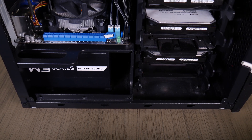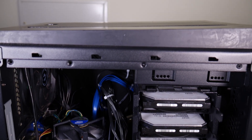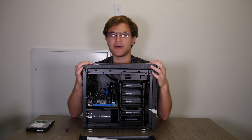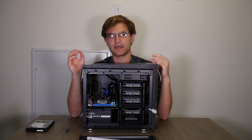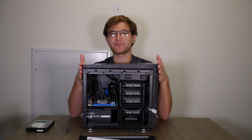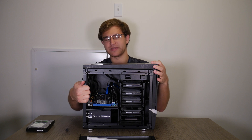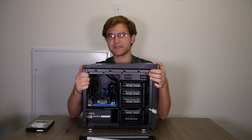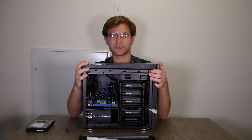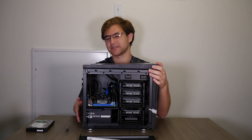In terms of case choices you're kind of limited on lower budget options — small form factor cases with lots of hard drive bays tend to bring a lot of money. This case is really not that small; it barely fits where I'm going to put it and there's quite a bit of wasted space inside. I did find a really cool NAS case for about $75, but the downside was it required a non-standard server power supply that was hard to find in good name brands and was expensive, so I went with this one since it takes a standard ATX power supply.